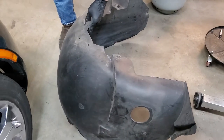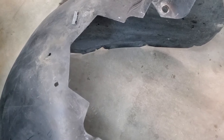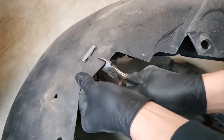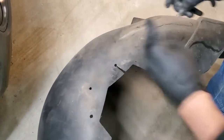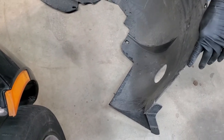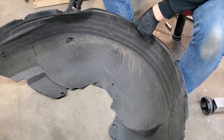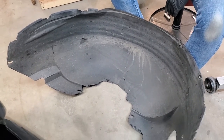This is the clip we need to recover — it holds part of the wiring harness in place, so we're going to save that clip. The way I'm going to do it is cut the plastic, because we don't care about this part at all. We'll use a good-size pair of side cutters and just snip our way through to recover the clip. There we go — clip's back. This one is quite usable, so we'll reuse it. Now we can see the total damage: broken here, broken here, broken on this point, this point, this point — almost all the attachment points are broken. It's shot; that's why we're replacing it.